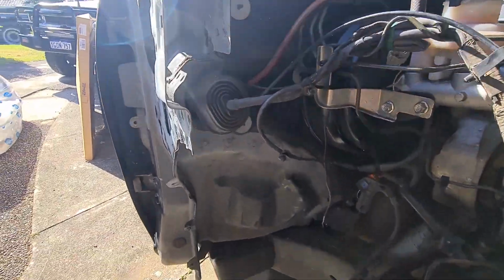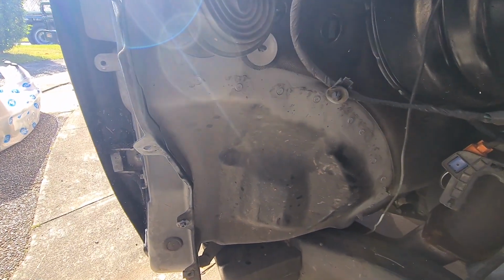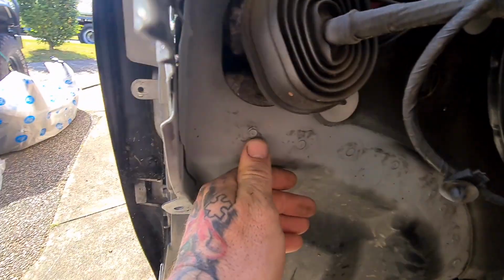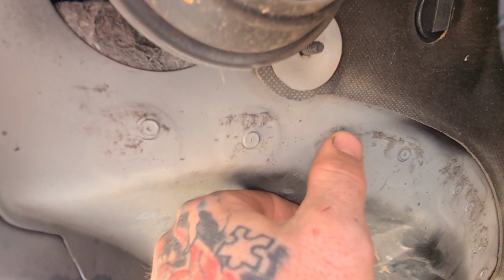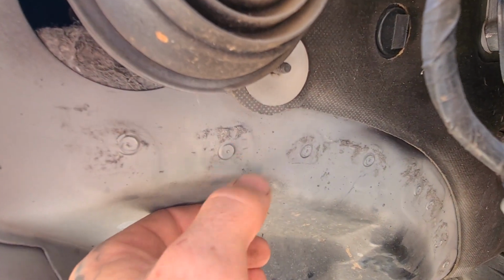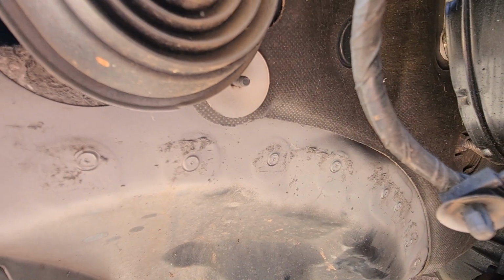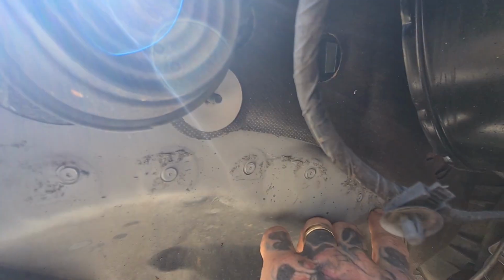So we used to have a guard in there. All our little spot welds we need to clean up. They're the little nubs you get left with the spot weld cutter. If you're able to do it from the right side of the panel, as we are here, we were able to get it on the right side of the flange so we weren't cutting into anything. We can go through and knock these off with a little grinder, and that surface will be nice and clean.